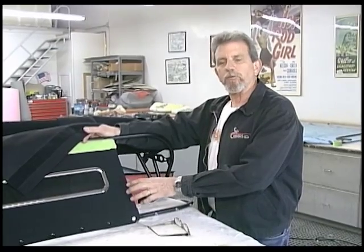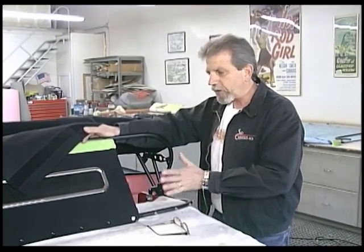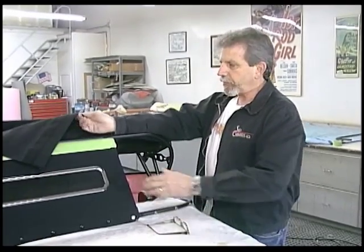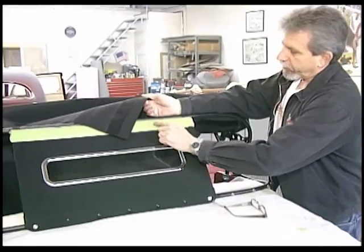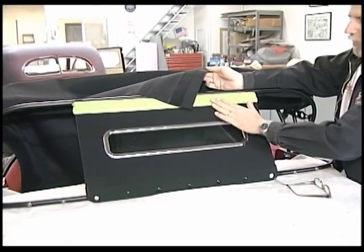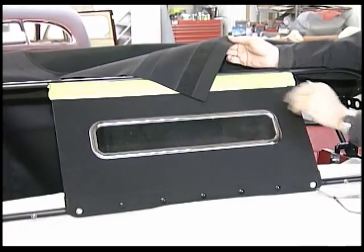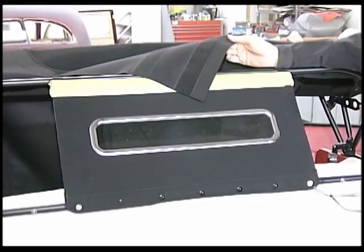The curtain's installed — now we'll put the skin on. All these next few steps pertain to the Bobtop that has a removable rear curtain. If you have a solid rear curtain, just snap this on and move ahead to stapling it towards the front. First thing we want to do — to help us out so we're not fighting the Velcro — is put a piece of two-inch tape across here so it'll slide and move easily and won't stick on you.